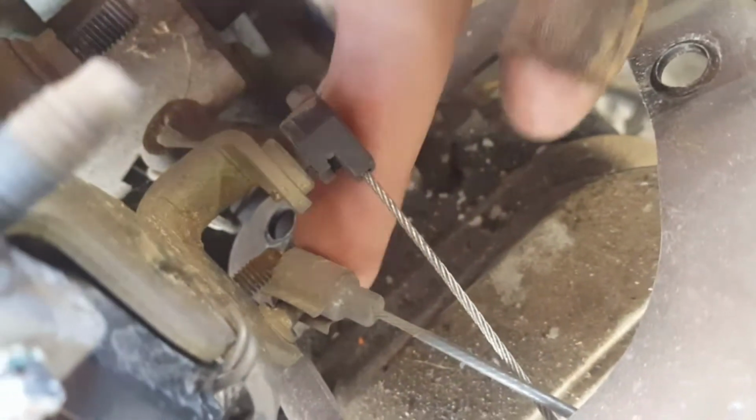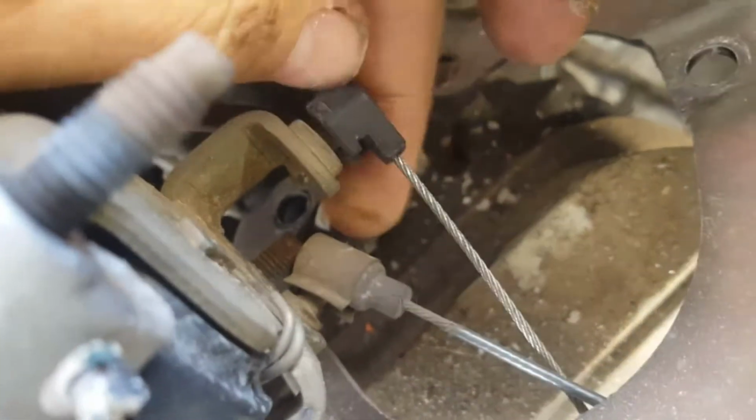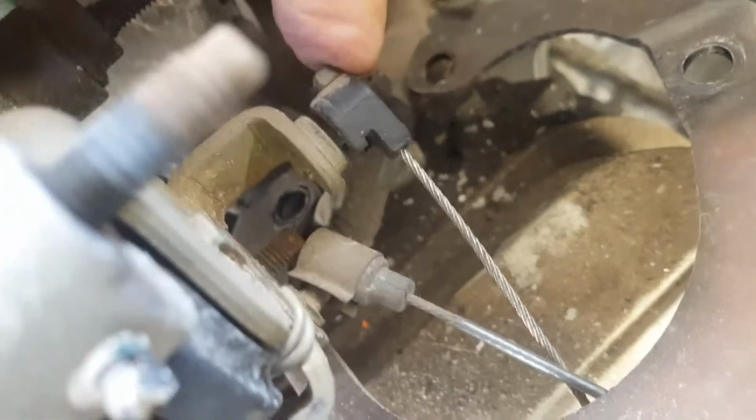Now what I've done is that practically just falls on the side. And then yeah, definitely those 2 cables have to come off. So the black one up the top, and that one, they just look like push clips. You could probably, without cutting yourself, use the flat-nosed screwdriver on that. And that black one has to come off, but they should just slide forward or just unclip somewhere. Just holds on those 2 cables, so do that now.